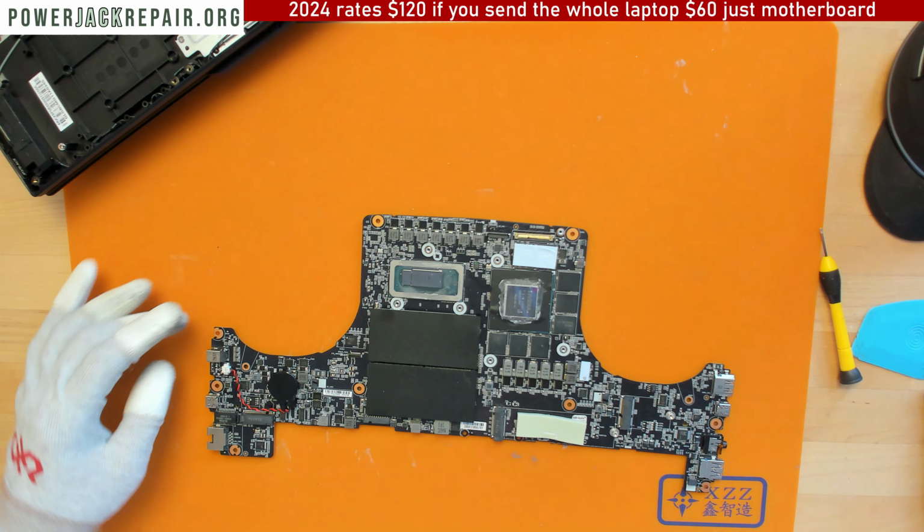Yeah, this board is nice and thick. Yeah, all right, so the factory solder didn't solder well because there was not enough heat on the board because of this plastic connector next to the connector. And because of that plastic connector being so close, I'm pretty sure they didn't heat up the motherboard the way it's supposed to be heated up, because that plastic will just melt.